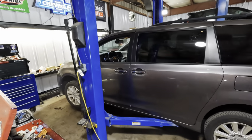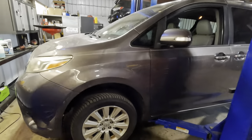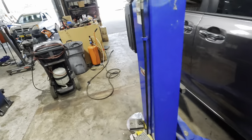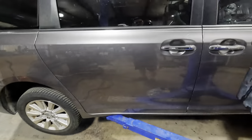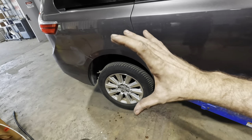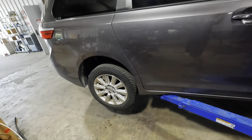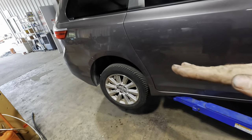We got ourselves a Toyota tow vehicle. This is a 2015 Toyota Sienna minivan with a 3.5 liter V6. The customer states that their trailer kind of makes this thing sag out a little bit. The van has a set of helper airbags inside of the coil springs in the rear axle, and those particular airbags have become dry rotted — they leak and no longer support the weight of the vehicle when the trailer is attached.